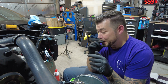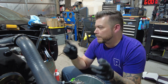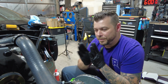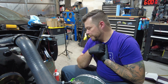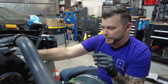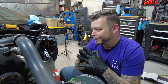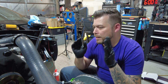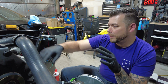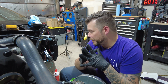So this is huge. This is great. So that's going to be it for this one. We are going to continue on with a few things. I need to figure out why the fan's not coming on when it reaches temperature. Maybe I'm not testing it correctly, I need to check the relay, make sure that's working properly. And clean up this wiring again. We need to figure out some of this loom. Part of the issue is that the loom that I bought is melting very close to where the headers are, so I need to figure that out as well. But so far so good. This is huge. This is awesome that I figured this out quickly. What I might do is just move this black wire, instead of undoing the whole thing, find out where it goes down here, and we'll do little swapsies, and we will figure that out.